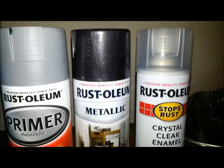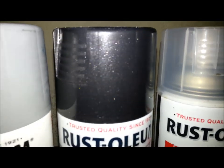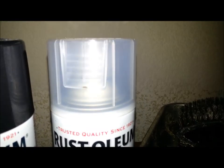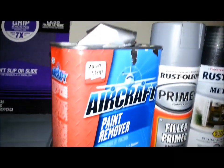For the paint strip, I'm using some aircraft paint strip remover — I just got it at the auto store. For paints, you always want to have your primer. Once everything is sanded down and after your 400 grit has been applied, spray on two coats of primer, maybe more. After that, paint on your color — in this case I have a metallic black. After that's dried, paint on your clear coat, which protects it from rust and doesn't scratch off so easily. I also have a paint tray for the stripper and a regular paint brush.